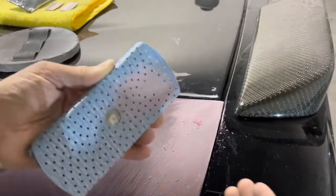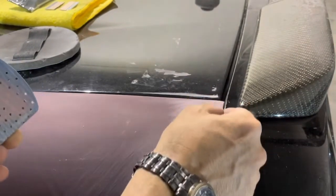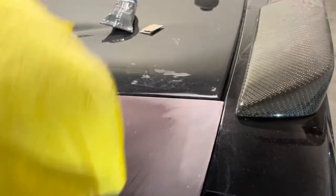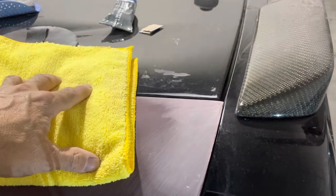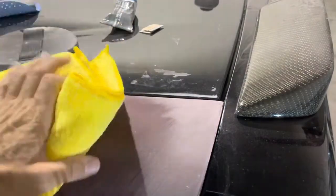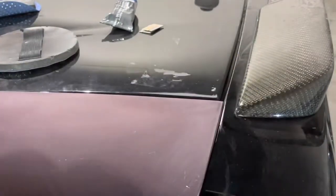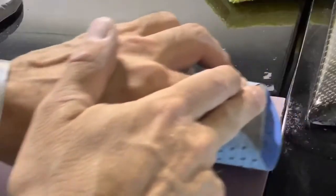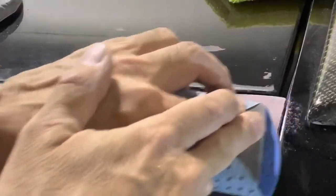The reason I don't like pooling is that when you go to put two panels together, like the rear bumper and the fender, you get a goofy-looking edge. Another thing I like to keep around when sanding is a brand new microfiber — do not grab one you've been wiping your car with, brand new out of a package — they're great dusting towels for bodywork. You can still see the shiny spot even after wiping it off. Don't use a lot of pressure; just let the sandpaper do its job, and unfortunately that means more work for you.